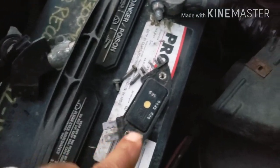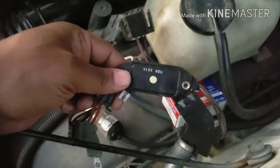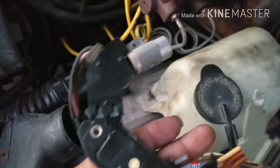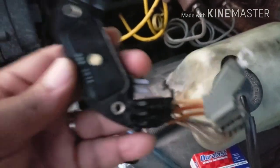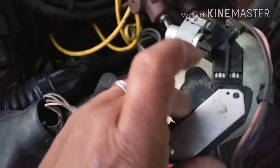That was the first module. Now this is the second module — I didn't even put any grease on it and in the same day it just still popped on me. So what I did was go to the junkyard and got another module with the condenser and some better electrical connections. It looked like it came out of a Buick Regal — they just put this thing in there, didn't have much grease on it.